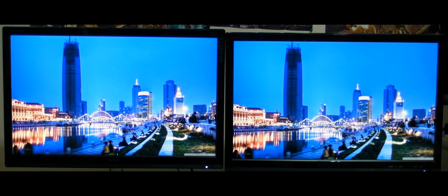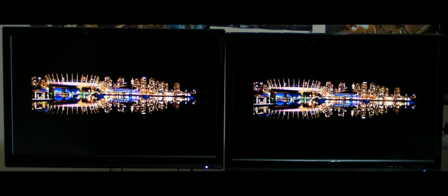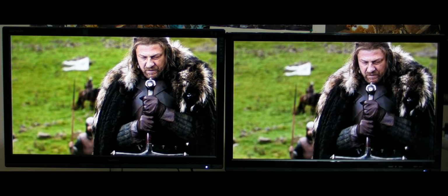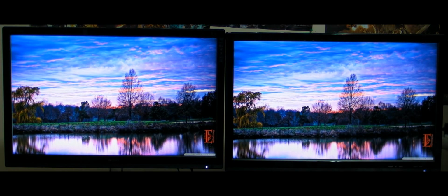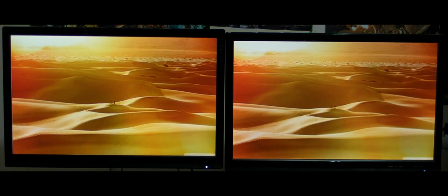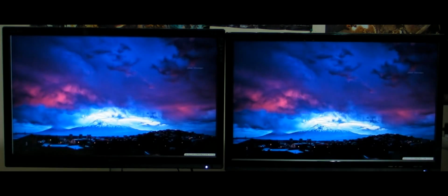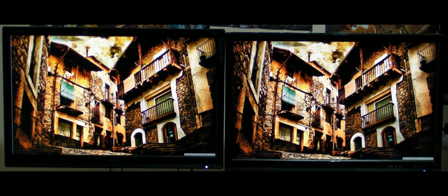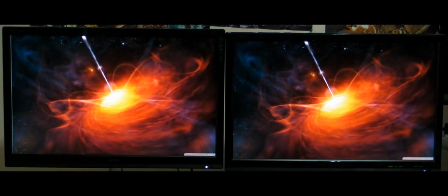Typically, with displays which use low LED PWM dimming frequencies, black lines will start showing up on camera with shutter speeds at 1/60th of a second. Using shutter speeds all the way up to 1/500th of a second, I was never able to see any black flickering lines on the Qnix, and I was unable to capture any vertical bands when using the PWM dimming method from TFT Central's article. My results have led me to believe that the Qnix does not use LED PWM dimming. However, I must mention that the Qnix reviewed by Dead from Overclock.ru only had a 160Hz LED PWM frequency. Either I'm wrong, Dead's wrong, or there are two versions of the Qnix, one which uses LED PWM dimming, and one which does not.